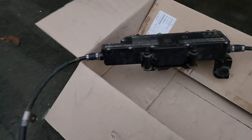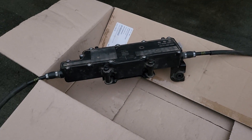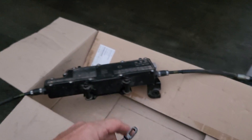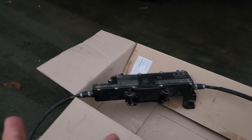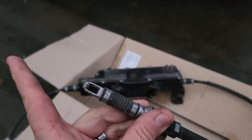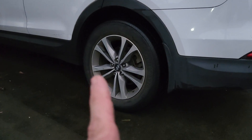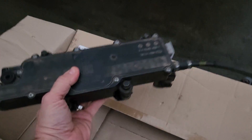The way it works is there's a motor in here and a controller board in there. When power is applied, this cable is lengthened out. It lengthens and then retracts, kind of like a winch. And it'll apply the handbrake on and off, all because of this EPB.